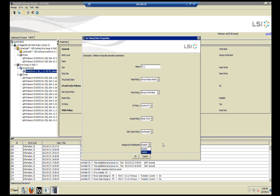Got it. But in a lot of cases, and it's totally understandable, and a lot of people do use it, they say, I want every sector on the drive to be initialized and make sure all media errors, if I have any, are taken care of. Correct. Before I start. For data security. Right. I'm not even going to install anything on the drives, but this is an option if I want to just get going faster and then still check it over time. I don't want to wait 8 hours.